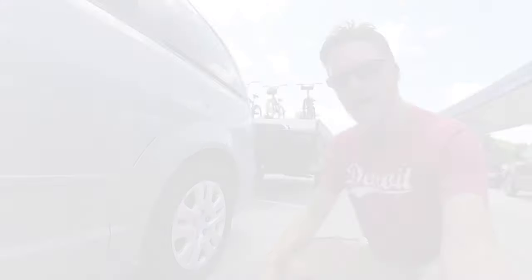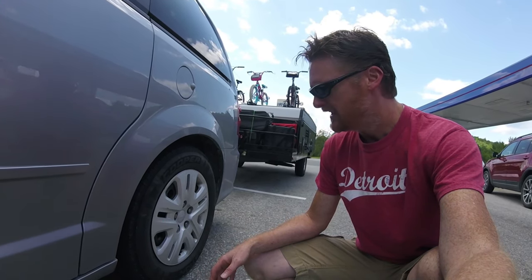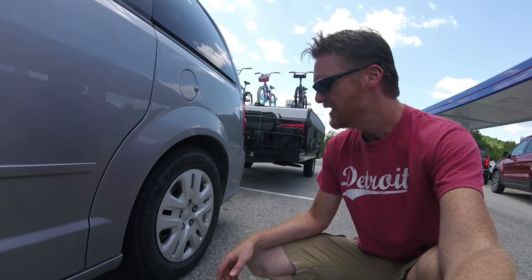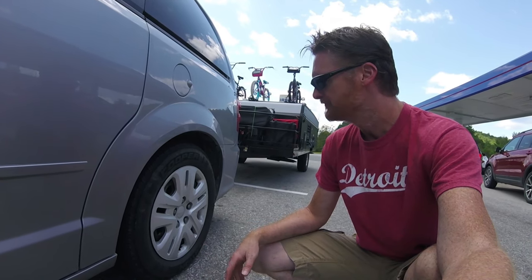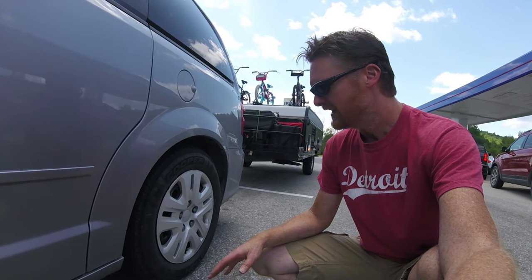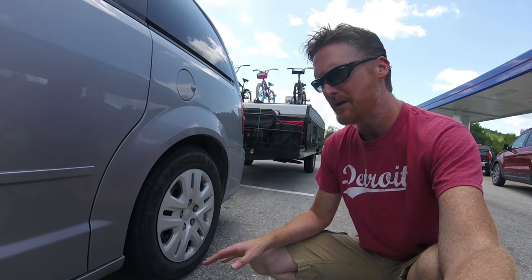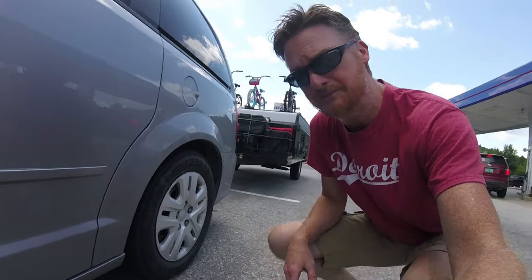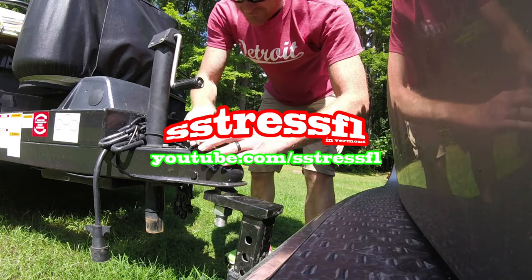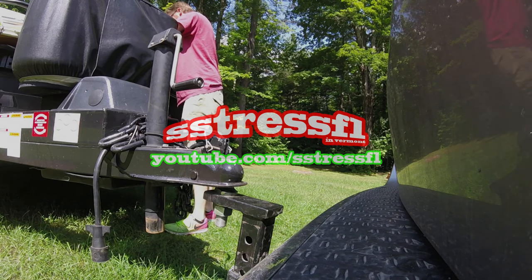I'm really happy with these — I'm looking forward to testing it with the towing load on it. In regard to the springs, the new shocks have basically the same support that the airbags have. The combination of the two gave me more ride height, but I had to put about 65 pounds of air in the airlift bags to get it to this level. So next year, load levelers are definitely going to be my next step. Today has been the best, most stable ride I've had towing this rig. It's working great, but it's really not the right solution — I need load levelers. But right now, today, I'm very happy with this.